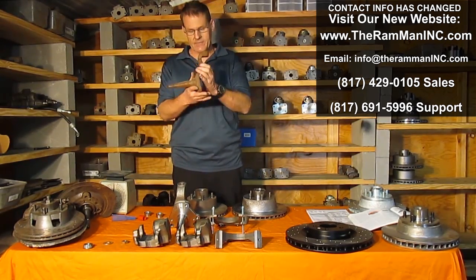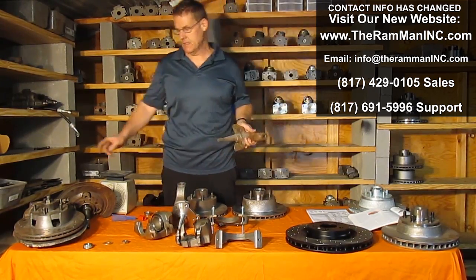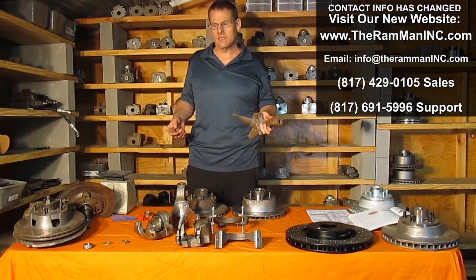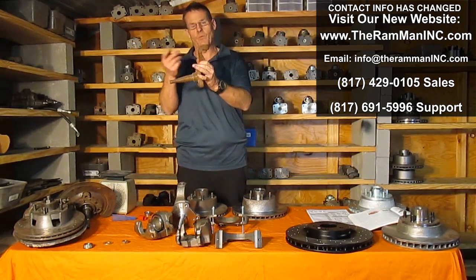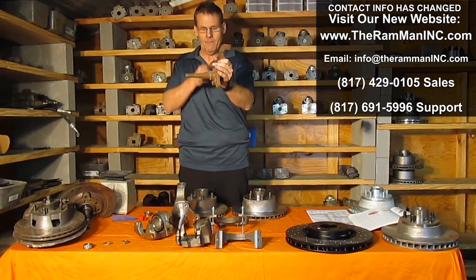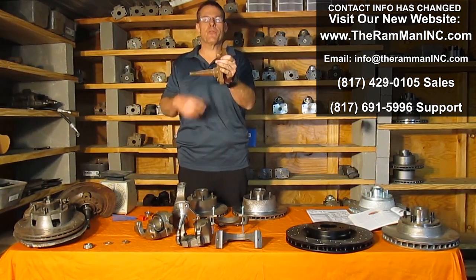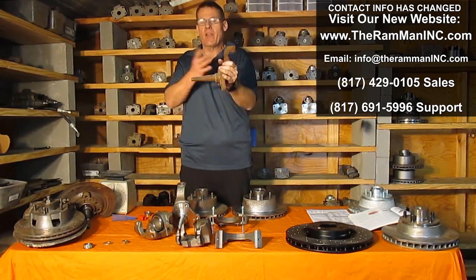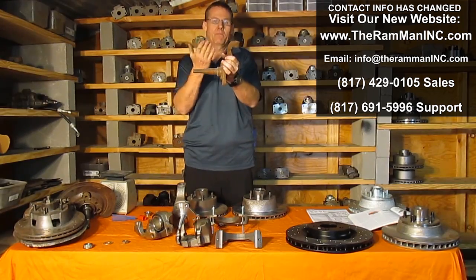Number two, those designs use a metal plate in order to hold the caliper, especially these Kelsey Hayes type calipers used on our A-bodies and our MOPARs, and a company called Stainless Steel Brakes uses these. The plate system never does work right. Number one, you're using a wrong spindle, and number two, it doesn't matter whether the steel plate is 1/8 inch thick or 1/2 inch thick. When this is subjected to 2, 3, 4, 5, 6,000 psi, the plate system is going to flex. Therefore, you'll never have great brakes, because the piston's pushing on the rotor and the plate's pushing back.